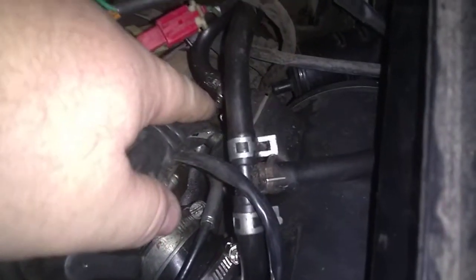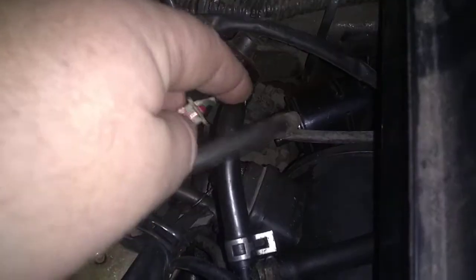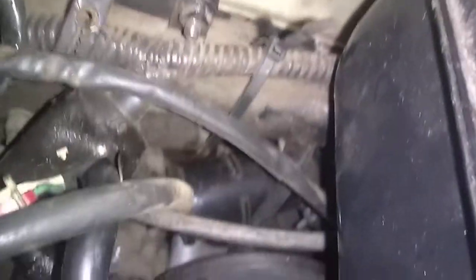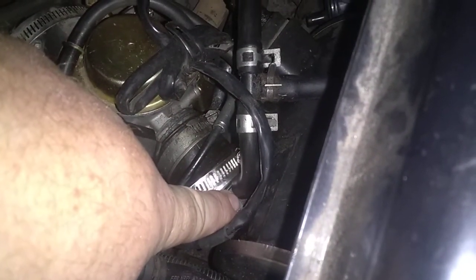There's a filter inside — a little sponge inside here. It comes from there and goes up to this hose here. This hose leads down into a T. This T goes off — you guys can see it back there — there's my charcoal can. So this hose leads off and goes to that charcoal can, and it T's off and comes down right here to the air box in front of the throttle valve.